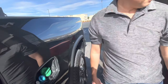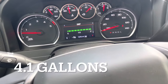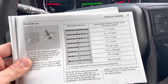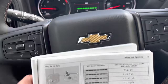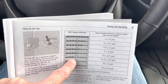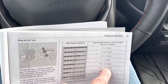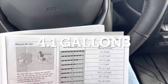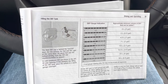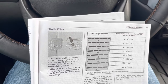Put our lid on — good to go. The DEF fluid is now completely full. I put about four and a half gallons in. I wanted to see exactly what the capacity of the tank was — it's about 5.3 gallons. If you see this little chart in the owner's manual, my level looked like this before I filled up. In order to get it full, it says to add about three and a half gallons, and it pumped in four and a half gallons. That seems right that it would only accept about 5.3 gallons. It's actually smaller than I thought — I thought the DEF tank would have been seven or eight gallons.